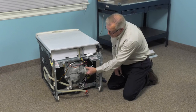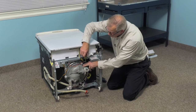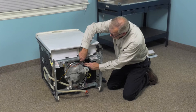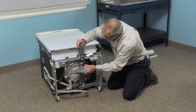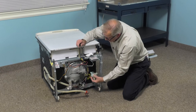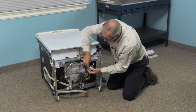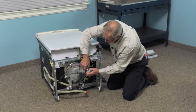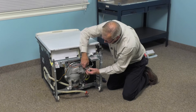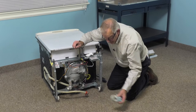To remove the drain pump motor, we'll need to release that little locking tab that is pointed towards the front of the dishwasher. With our flat blade screwdriver, just gently push on that and rotate the pump counterclockwise to remove it. You can also disconnect the wire harness connector to that pump — just press the locking tab while pulling up on the harness, and set that pump aside.